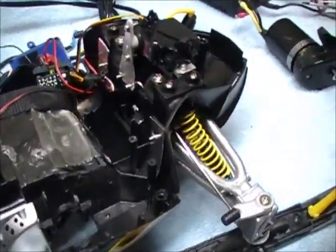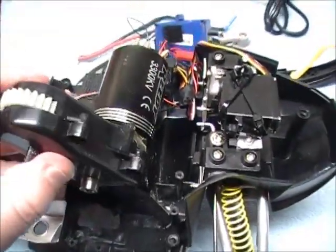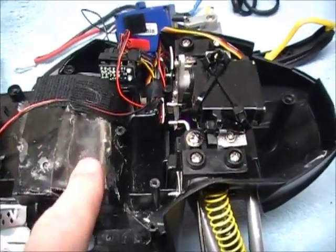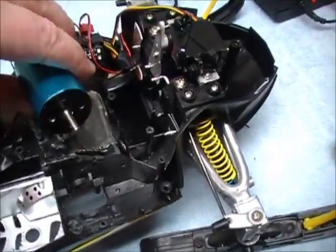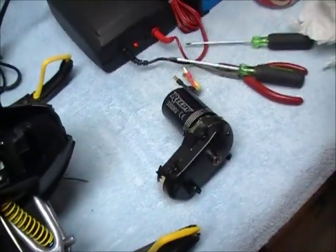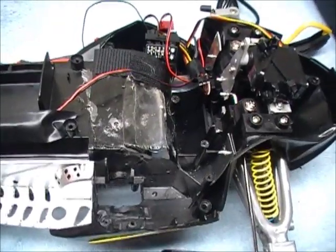Here's the chassis with the motor removed. You'll see that I've cut out a large hunk of plastic that would normally be in the tunnel area so the motor can basically drop down into the level it needs to be. I put a little bit of fiberglass in here to block off any water or snow that might come in. Looking at it from the bottom you can see the hole — otherwise the motor just won't fit. You could go with a smaller motor which drops right in without any cutting; it's much simpler, but not quite as powerful. So depending on how much power you want determines what mods you need to do.